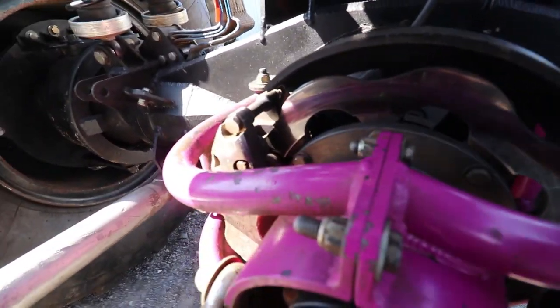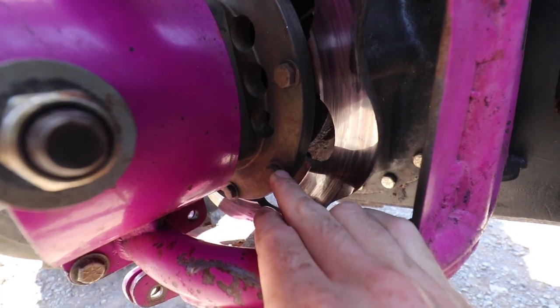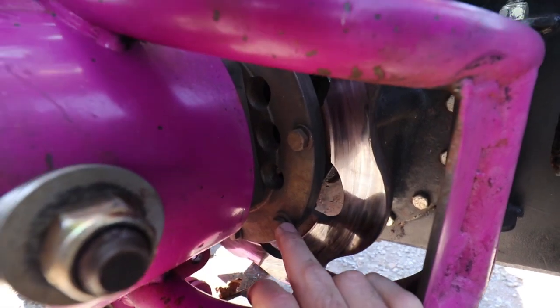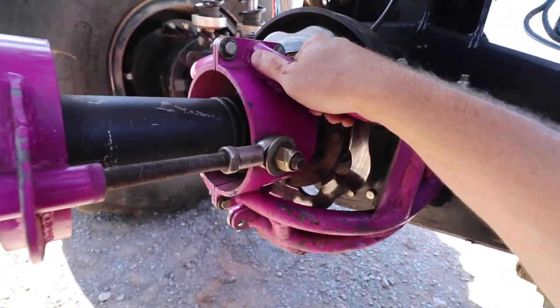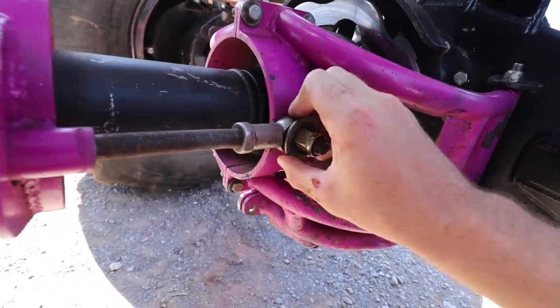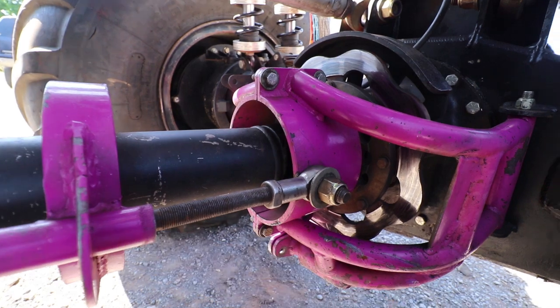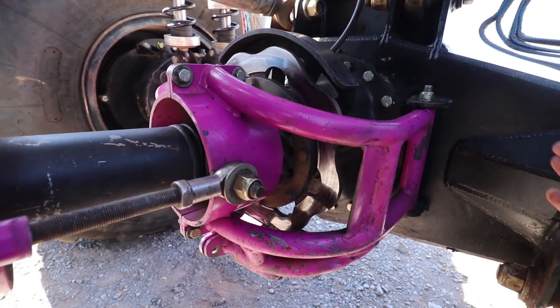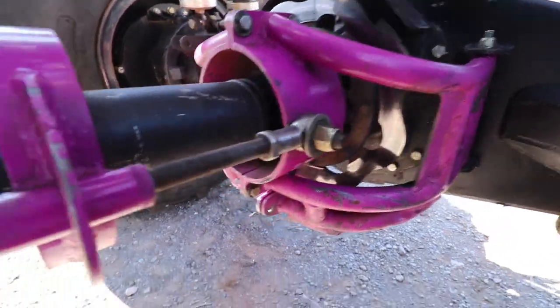Right here is the caliper - it's not wanting to open and close. Also I just discovered these little bolts right here, I have probably four or five of them loose on the rotor. We're going to unbolt these - we call these clamshells right here that go around the drive shaft and universal. Take these rod ends off on the drive shaft loop, slide these up, then open these clamshells up and it'll expose the whole braking system. We'll be able to get to it no problem.